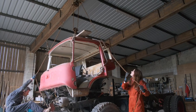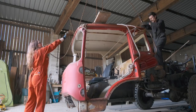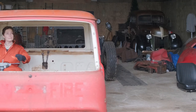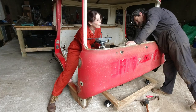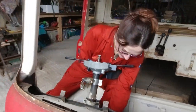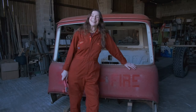All of this culminated on the day we removed the cab from the chassis — a delicate but also somewhat heavy operation involving a block and tackle, a fortuitously placed iron beam, a bit of ingenuity and some elbow grease. With the cab bolted onto a moveable frame on wheels, we were almost ready to begin the restoration. There only remained the internal gubbins to remove: all the electrics, the wiring loom, the dashboard panels, pedals, and most tricky of all, the steering column. But it came out eventually, and then we were left with the bare shell of the cab.